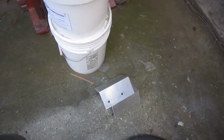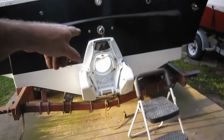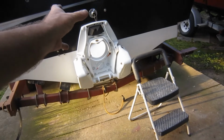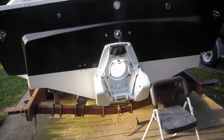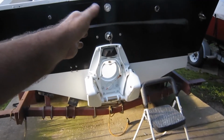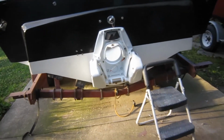And that means exactly, like shake it around, make sure it's all pushed into where it's supposed to be in the transom shield. That kind of dictates exactly how the motor is going to sit anyway, is the transom shield. It's a weird thing with Volvo. Makes them real easy, no alignment issues, none of that crap. But the motor lines right up with the transom shield, so if your transom shield's kind of crooked one way or the other, your motor's going to be crooked too.